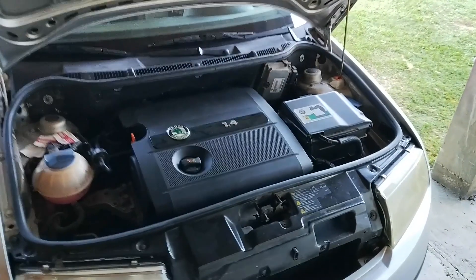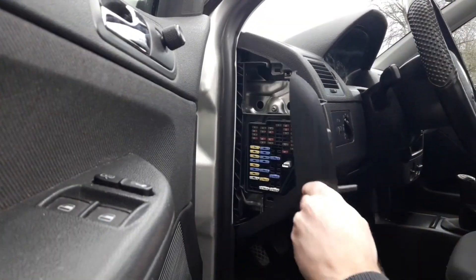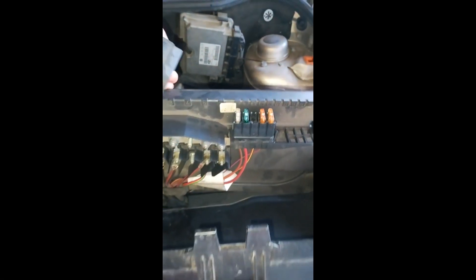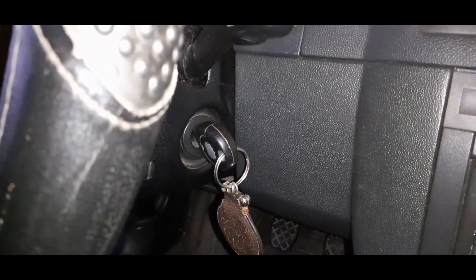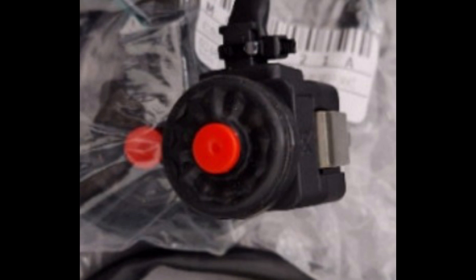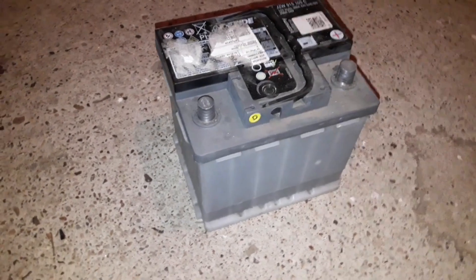But if all of this did not help with this symptom, which is not that unusual in modern cars, other things worth checking are: the fuses — know that on lots of cars there are numerous fuse box locations, some are pretty hidden, so take a look at your user's manual. The fuses that may be burnt out are usually located somewhere around the battery. Check the ignition switch — this is even more rare of a problem, but when the switch is faulty it can cause these symptoms. Check the ground connections — check that every ground connection to the car body and the engine from the battery is clean and tight. Also worth checking is a faulty kill switch or some sort of anti-theft system. In the vast majority of cases, a bad battery or bad contact on the battery terminals will cause this symptom.